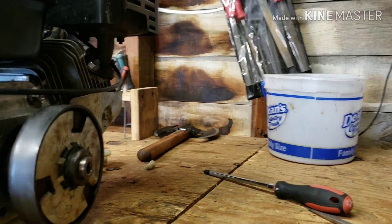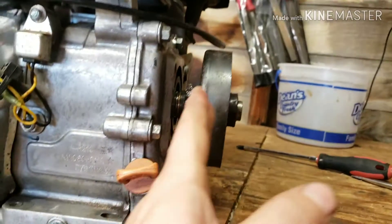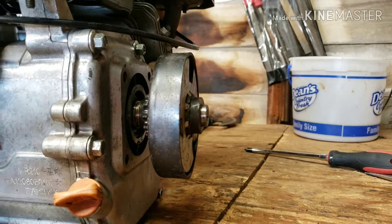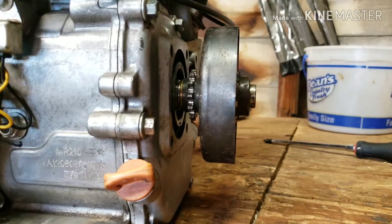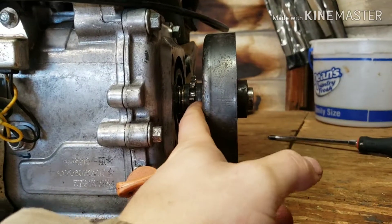I was waiting on oil for this. I actually got this clutch all tuned back up and in place. Before, it was just loose on the shaft and it would wander. And when I'd give it gas — a hard acceleration — the whole motor would twist over like this, because the chain was pulling on it, and this would walk out and then pop the chain off. So I've got to reinforce my motor mounts and stuff.